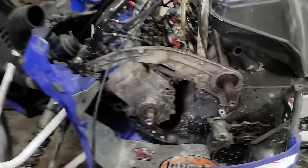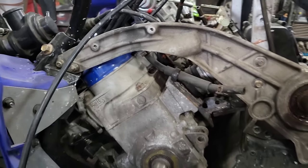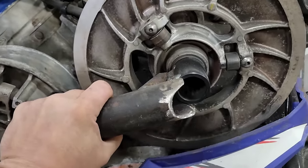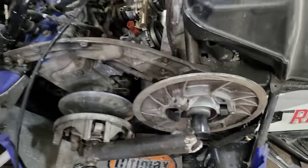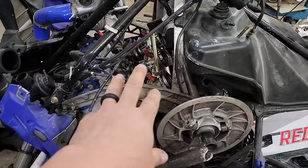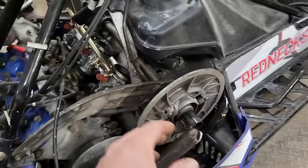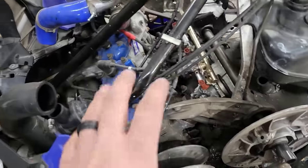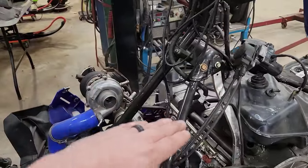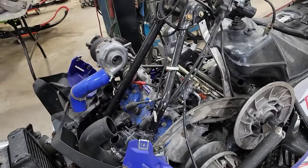The motor is completely installed, locked in. All the motor mounts are made, she's rock solid — there's no rubber isolators or anything like that. I made this alignment tool: took a stock secondary and an old primary, keyed it on there just like so. That helped me lock this thing in to where it needs to be. I tipped it so I got the throttle bodies, because we are fuel injecting this, and I had to make these throttle bodies up. We needed the angle to clear the stock motor mount, the jackshaft. Put the fuel tank in so we know what room we're working with, got it tipped down so the exhaust is coming down into the front belly. I got the stock turbo basically lifted up from its original position — it still clears the hood panel, it's going to be close, we're going to have to put a turbo blanket on there.